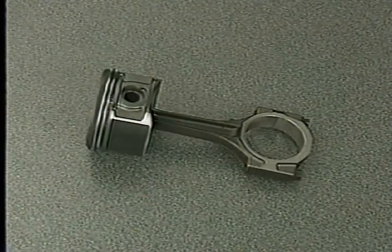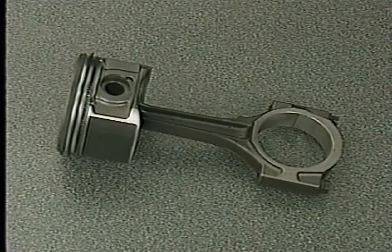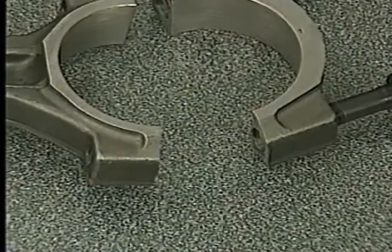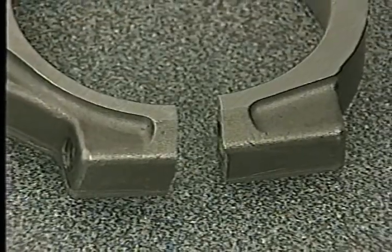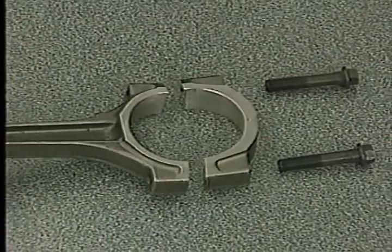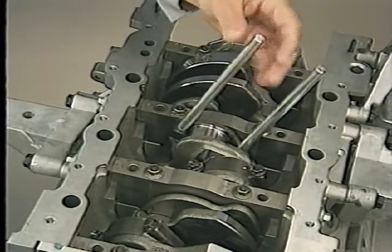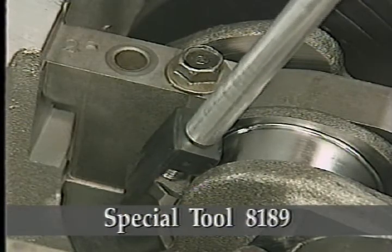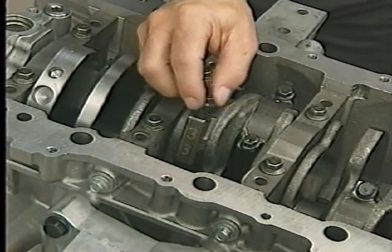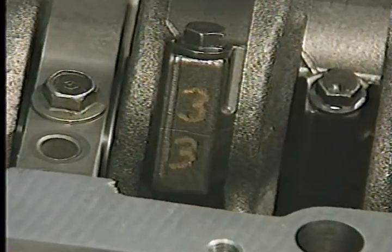On the 2.7, 3.2 and 3.5 liter engines, this should not be much of a concern since the piston and connecting rod are replaced as an assembly. On 2.7 liter engine pistons, notice that the connecting rod was fractured during manufacturing to form the connecting rod cap. The connecting rod cap bolts are captive fasteners, but since the bolts should only be torqued a limited number of times, they can be removed and replaced. To avoid damaging the cylinder bore, the crankshaft journal, or the cap itself, use special tool guide studs 8189 when removing and installing the pistons. As always, with a fractured rod cap, it's important to make sure you mark the cap so you can install it in the original position. Do not mark the caps by stamping them — use a marker or paint to avoid damaging them.